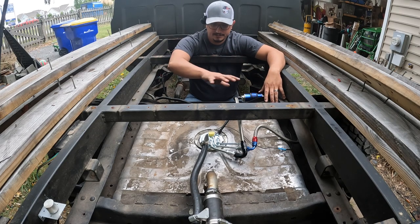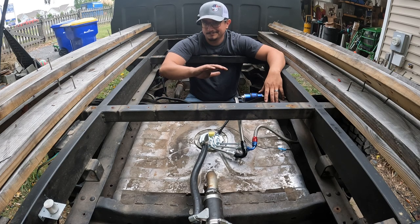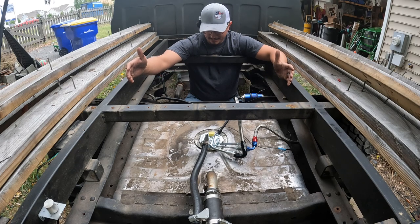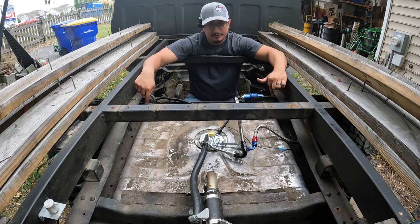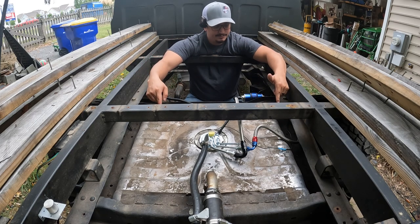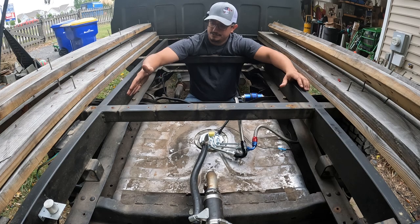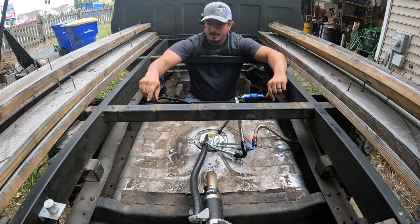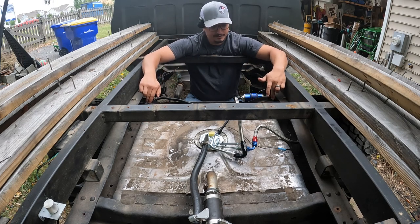Doing this is not hard. If you're not sure you want to do it but you're a little scared, don't be scared — just dive in. It's nice and easy. All you really have to do is drill four holes and cut this one crossmember. This crossmember right here is actually mounted on the bottom section of the frame crossmember. What you have to do is cut the rivets off — I'd recommend an angle grinder. Just do an X cut, grab an air chisel, and chisel out the rest. It'll drop right out. So it's on the bottom, about that far back. Flip it upside down and move it up here.